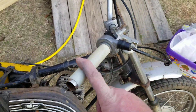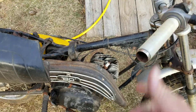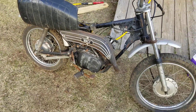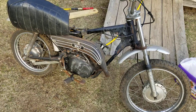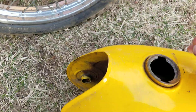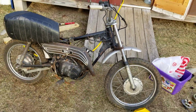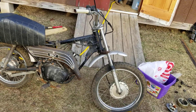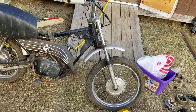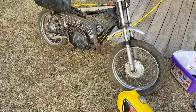I know I need a throttle grip, which I might have. I'm going to need a throttle cable and a new grip — this one's broken off. Switches feel good. We're definitely going to need tires and tubes. Doesn't look like any spokes are ripped out or missing — I already checked that. This thing's in pretty good shape. The tank is in excellent condition — it's clean in there. So realistically the coil, the mount, a proper plug, and then we'll take a look and see if we need to do a top end. We have no idea what happened to this bike — it's been sitting for a very long time. It might need brakes too.